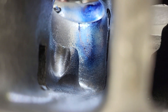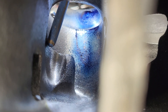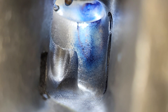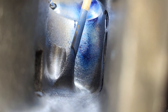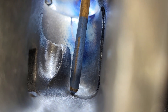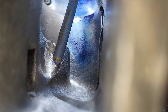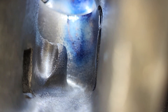Let me show you — I'm going to try to one-hand this. This is a curve up right, and this is a curve this way, and this is the deepest point here. What was interesting is I did a little string test, and sometimes the string will follow right up this curve and then fight to get around the other side. A lot of the air still wants to go around the high helix even though air speeds at the roof are definitely slower. I'm fighting with myself whether this edge needs to be easier for the air to get around or more aimed to go up this way, since this is the unshrouded part of the bowl.